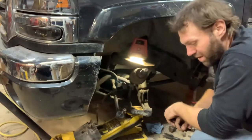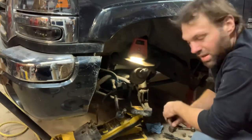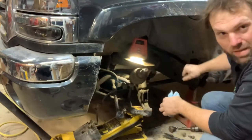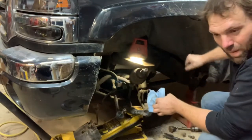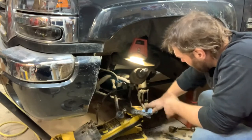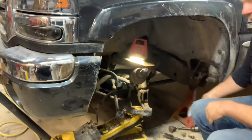We had to heat the axle shaft, and this was a pretty rust free truck. It didn't have a lot of miles on it or anything, about 55-ish, 60-ish thousand, and the ball joints were shot, obviously, because it's a Dodge. And yeah, we had to heat it up and then you'd rear it and it'd go ding as it would move, just the slightest bit. Then you had to catch right up again, a little more heat on it, go right up tight, pulling, and go ding and move just the slightest bit. That was pretty interesting. And this truck, good Southern truck, it's not rusty. You'd probably play hell doing this on a New York truck. But anyways, I digress. So they're all out.